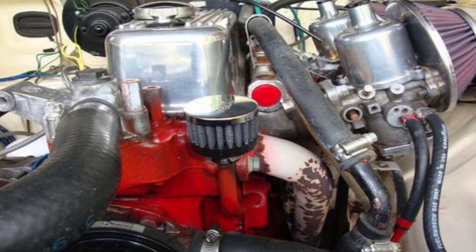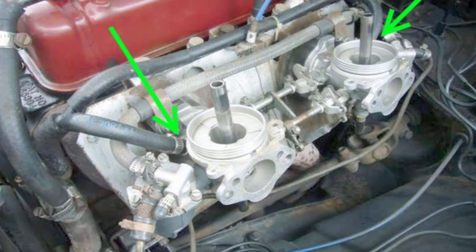The first solution was to route crankcase gases back into the inlet manifold, recycling them — they contained useful hydrocarbons and unburnt fuel which the combustion process re-burnt, reducing polluting gases. That worked well until you were at 5,000 rpm and lifted off the throttle, at which point the very high manifold vacuum used to drag things out of the crankcase including oil, and in bad cases pull seals.